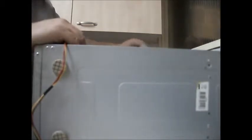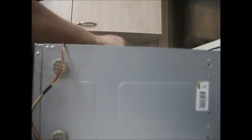So, I've just fixed the motherboard in. I've had to change the power supply as well, because I needed a 24-pin connector, and the one that was in here was only a 20-pin. I'm sure we've got to connect around the right way. The best thing is, if I want to upgrade to SATA in this, I can. So I've got the SATA connectors on the power cable, that is.